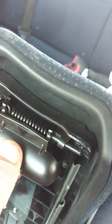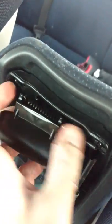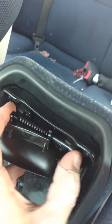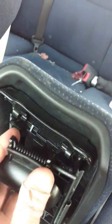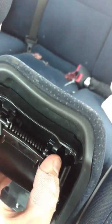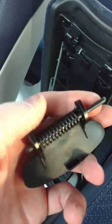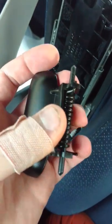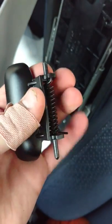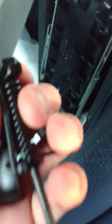You just slide this pin out like that. Once the pin's slid out, you can move it this way. You might have to jockey the pin a little bit, but you shouldn't need to pry, you shouldn't need any pressure. If things are getting tight, just slide the pin and it will pop out just fine. Here's the latch with the pin and spring installed. When you buy the new latch, you will not get a spring or a pin, so make sure you save your old one.